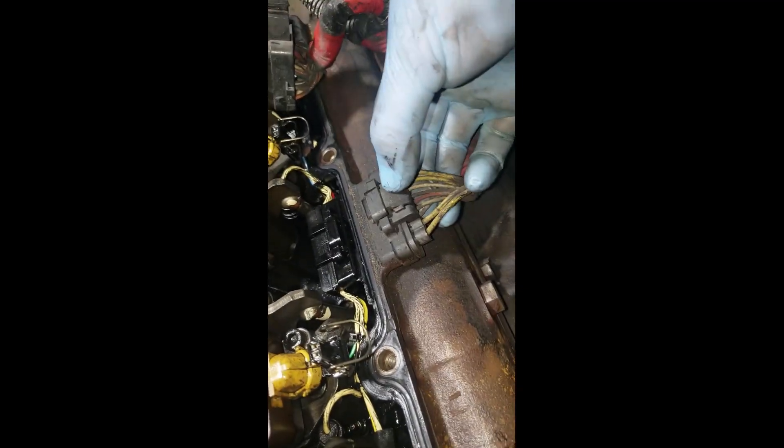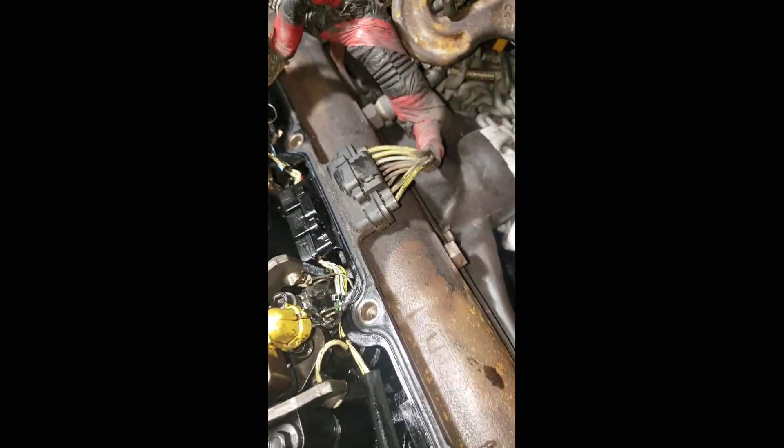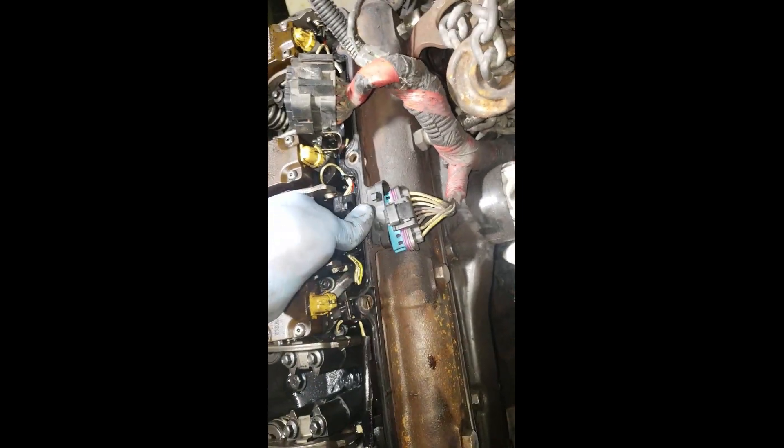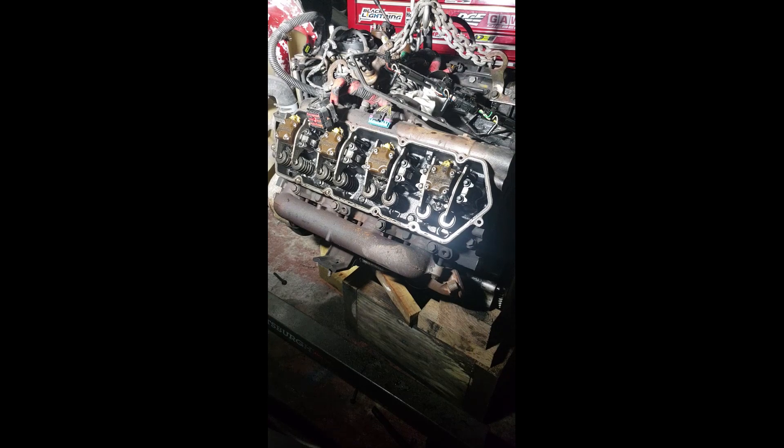Now what I like to do is remove this little bracket first. I need to press it downwards to be able to pull it out, but I need both hands. So what you want to do is press on this downwards so it clears these c-shaped plastic corners that hold it in, and then slowly pull it out. It tends to be stuck, but pull it out and set it aside.